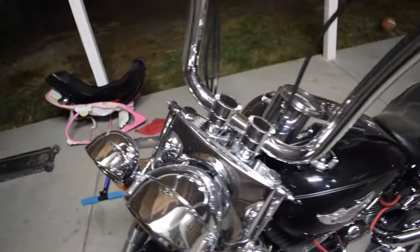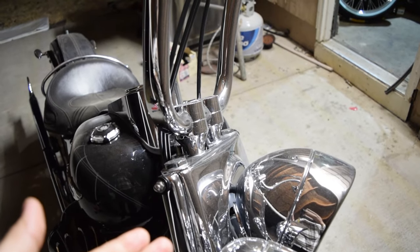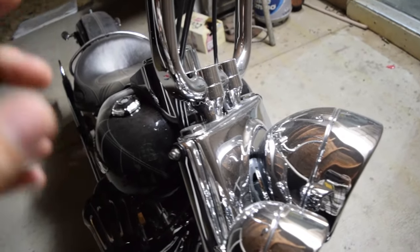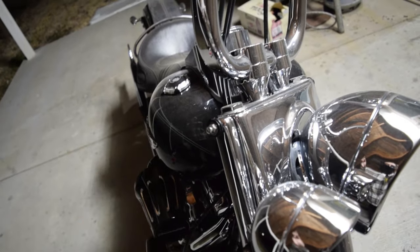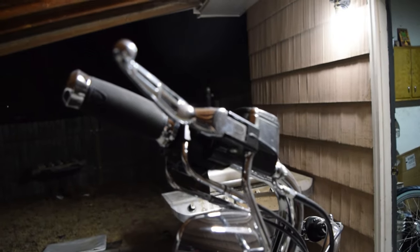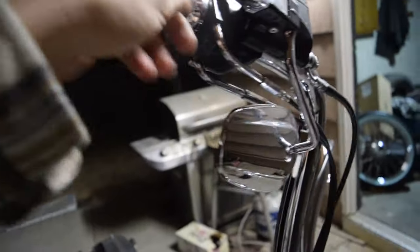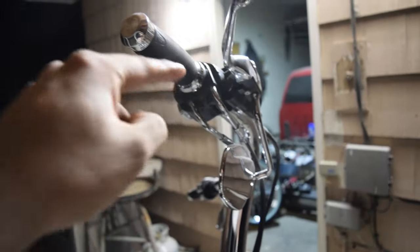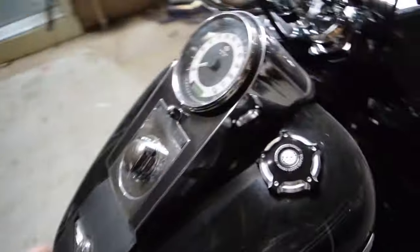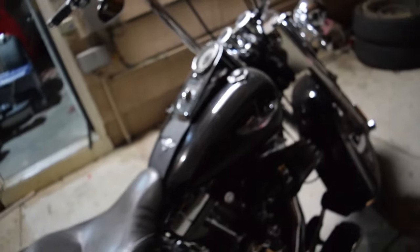Also, he put on these bars. Couple of things - he didn't run the solid risers, so they have like the tiniest bit of play, which ain't too bad. But I got some solid ones we're gonna put on there. Whenever he put the bars on and changed the controls, he didn't put the little spacer for the brake light plunger that goes here. So they were just on the entire time - you turn the bike on and it would have a little red dot right here on the gauge cluster. And that's not cool, so we're gonna try to get that fixed up.